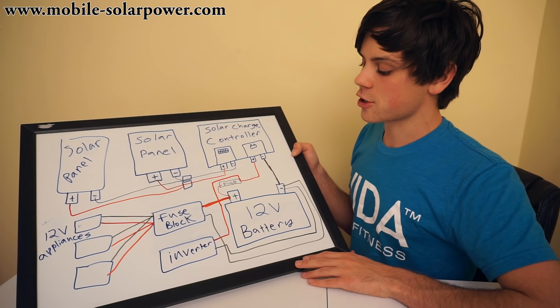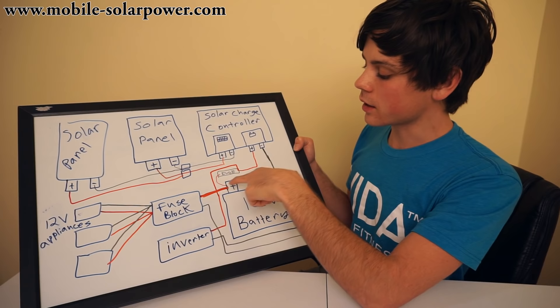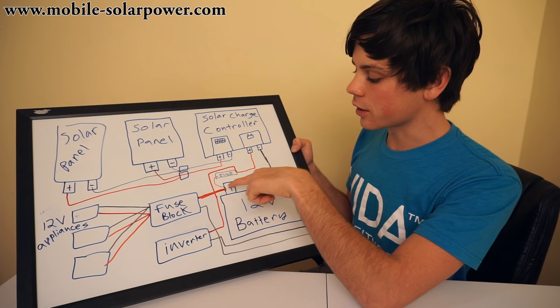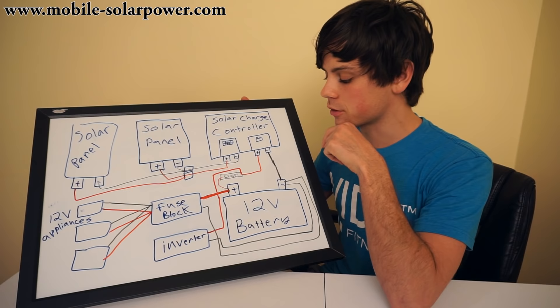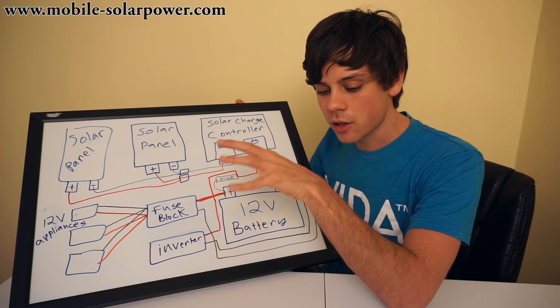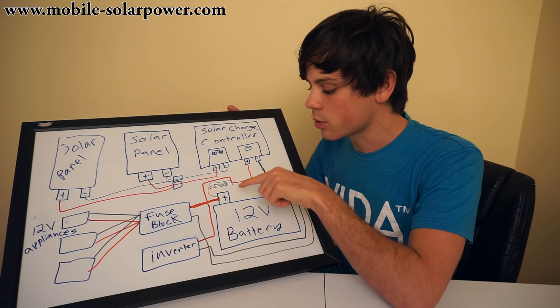Let's talk about safety. If one of these wires touches another wire, a fuse will blow. But if the fuse block is connected directly to the positive terminal and a wire touches another wire with no fuse in line, even though it's a fuse block, this can catch on fire, get really hot, and cause other things to combust nearby. So whenever you connect something to the positive terminal, it needs to be on the bolt-on fuse. Some fuse blocks can actually connect directly to the positive terminal, which is very convenient. But the positive terminal on the battery is the one spot you need to be very careful of. It needs to be protected from other metal objects and water. The negative you can have exposed — it doesn't even matter. But the positive on the battery is where the problems can occur. You need the fuses on there and you need to protect it.